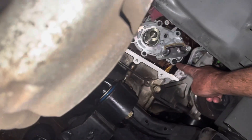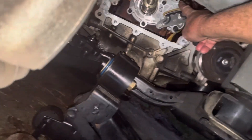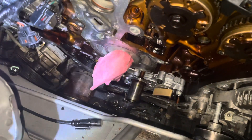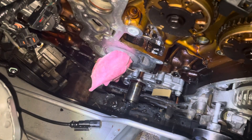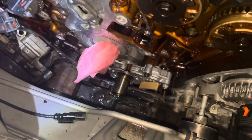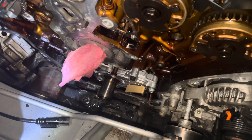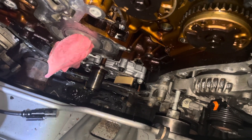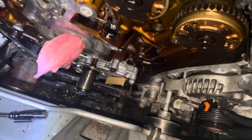I've now installed the oil pump. I did not have to prime it — when I spun it around with my fingers it had grease or a sticky lubricant already in it, and when I blew on the inlet it held pressure, so it'll probably prime without pouring oil into it. The old oil pump had little plastic spacers to help center it up — the new pump doesn't have them, so I'm going to try to put them back in. The three oil pump bolts — one right there, one below it, and one on the side — are all torqued to 18 foot-pounds. By the way, the oil pump comes with the chain guide already built onto it, so you don't have to use the chain guide that comes in the timing kit.